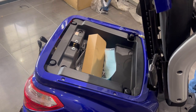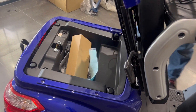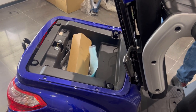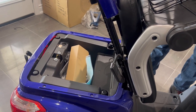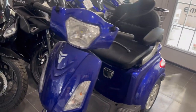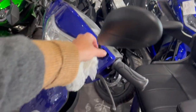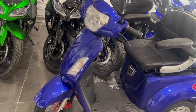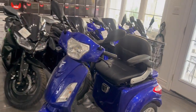Your batteries are underneath this bucket — there are four screws to take the bucket out to access your batteries. If it's a lithium, we put the lithium in the bucket so it's a super easy in and out. Just remember to turn your breaker off before you take out the lithium battery. Here's the completed product — we put the mirrors on; I have another video on how to put those on. Darren just put the covers on for the bolts. Thanks for watching!